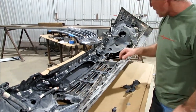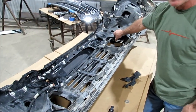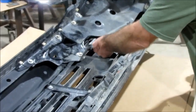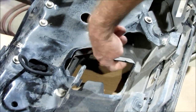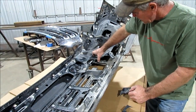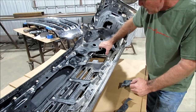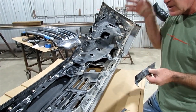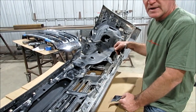While we're here, we've already notched this thing. On the outside, we've got a bracket that goes to the outside of the frame that needs to go in there, and this is closed in. If you look on the front of the bumper, there's like a little groove right there that we cut straight down. Once we cut straight down that groove, right there from the middle down, you've got to notch just a little bit more to get that bracket in there because that's where that bracket is going to be fished through. So you do have to notch that valence out right there, and that's also where the tow hook is going through.